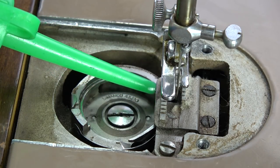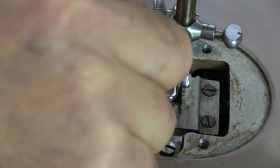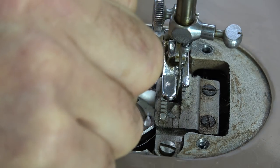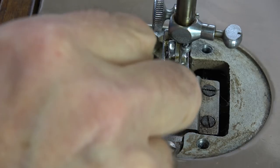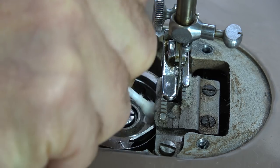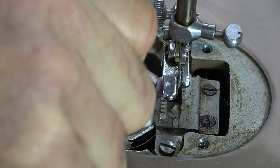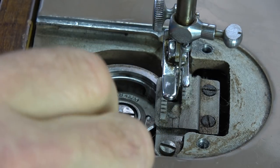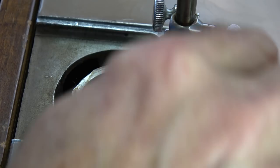Out it all comes — and it's worthwhile, while you're at it, getting any other bits of loose debris or dust out and giving it a nice spring clean. You can then pop a bit of oil in. You can sort of wash it with the oil to a fair extent to try and get the crud off. Get nice and clean and get that oil along the groove where the shuttle hook rotates. Right — that's a lot happier than it was.